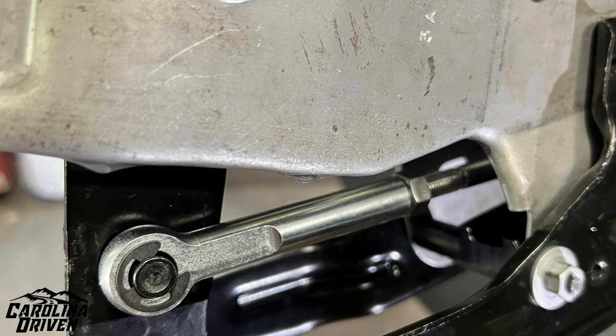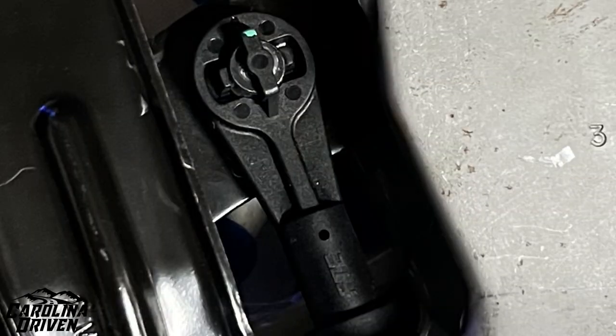Also looking at the picture, the rod that actually connects to the clutch pedal on the Tick Performance master is all steel and clips in with metal, versus the OEM one which is all plastic. I was even complaining about how I thought it was going to break — and then 20 minutes later, I was reminded: hey Zach, you bought the Tick Performance one. So literally, pulling the pedal back out while fully bolted in, swapping over the masters, and bolting it back in took two minutes.